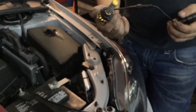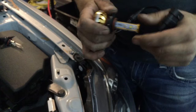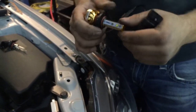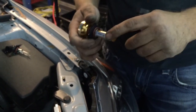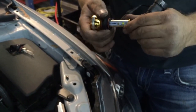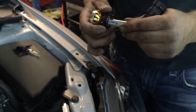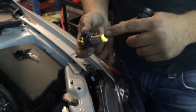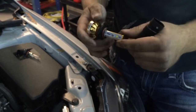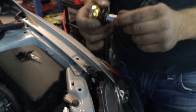So here's a 9005 LED bulb. Make sure that these are tight — I've had these vibrate loose because out of the package they're not really tight. You can change the glass to 3000K, which would make it yellow, or you can make it more of a blue, like an 8000K. Just make sure you screw this on and make sure it's nice and snug. These are glass, so don't over-tighten them and be careful not to drop these — they will break.